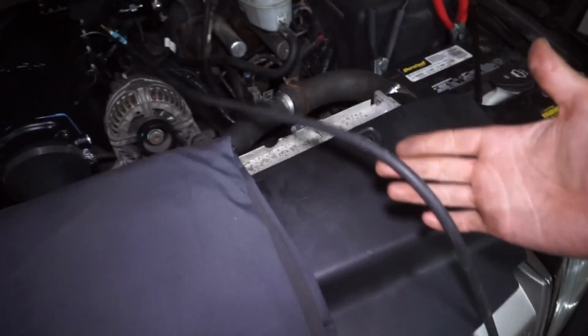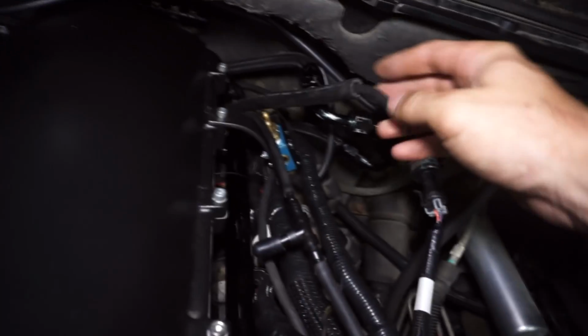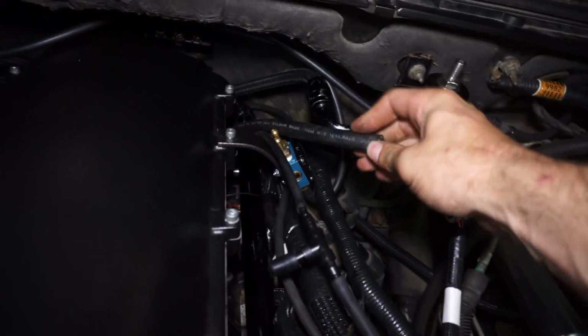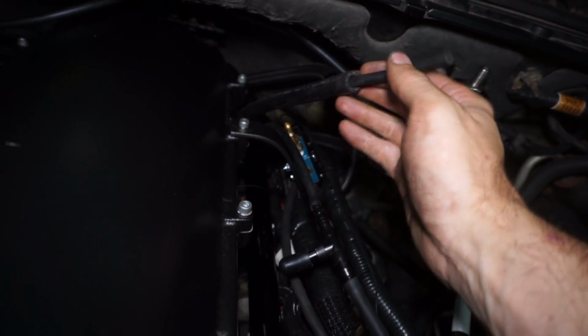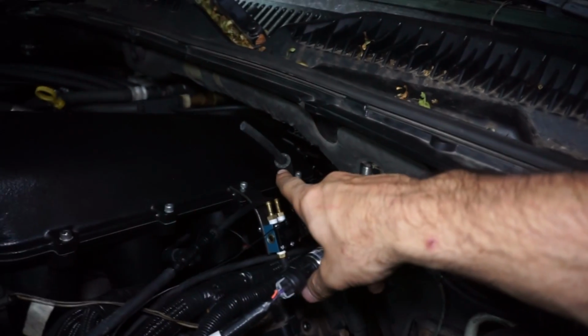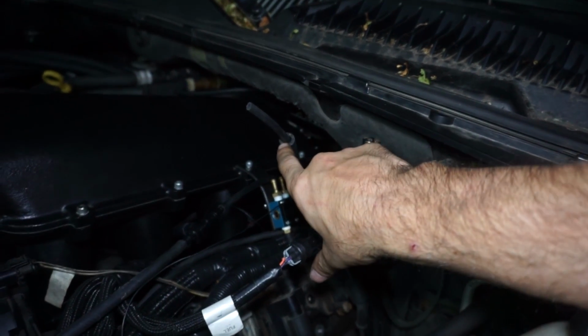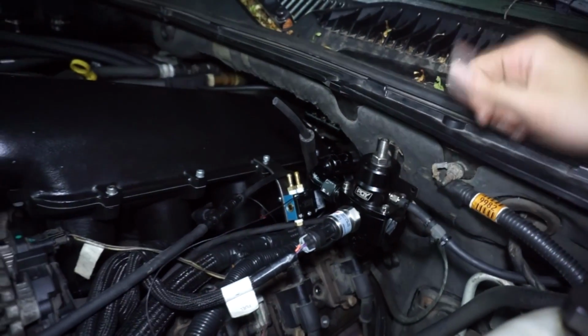All right, so I'm doing a check on the vacuum lines because I'm adding the boost controller right now. I just checked the bottom line. Bottom line is good, but the bottom line is also wrapped in fuel line. I usually use a 3/8 fuel line or something and run the vacuum line through it when I'm running it through stuff or it's by a heat source. Especially on the bottom line, because if the bottom line breaks, you're basically pinning the gate shut, and you can spike the boost pretty bad.